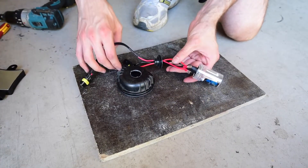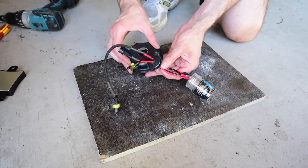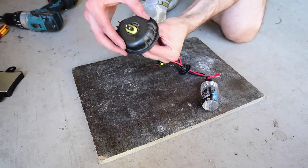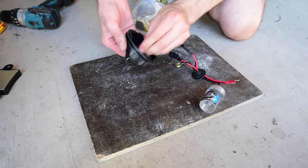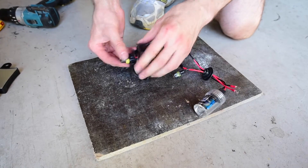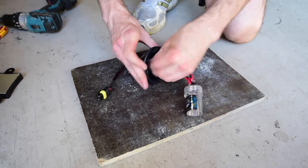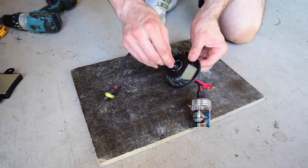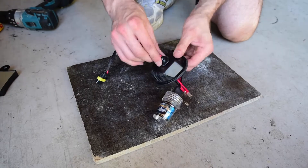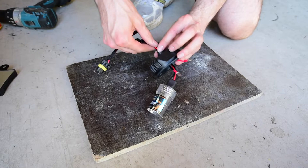So now what we're going to do is feed the HID loom through the cap. You want to make sure you do this the right way — in our case this is the inner side of the cap, so that's the side that the HID is on. We're going to be feeding these plugs through to the outside. Usually one of the plugs is a bit hard to fit through because it's very big, but with a bit of pulling you'll get it through. Then we've got the last two smaller ones coming in. Pull one side of the grommet through so we've got grommet on either side — this helps to keep it nice and weather tight.